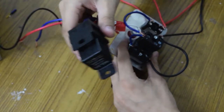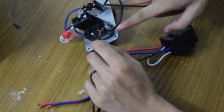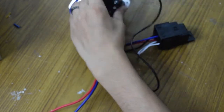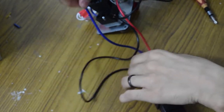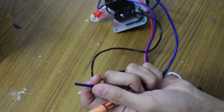Everything is complete. I'll attach the relay ground cable into the second terminal which is just for the ground. Now it's time for the live wire, the starter, and the ignition cable — the main ignition cable that I have to tap into the starter wire.